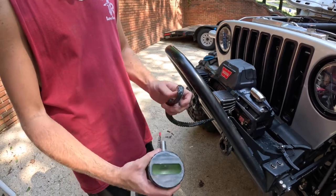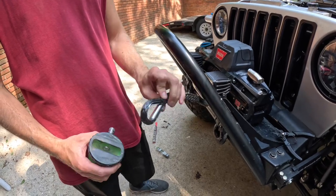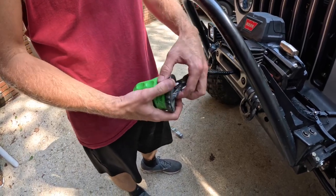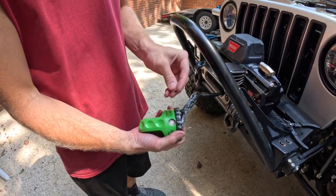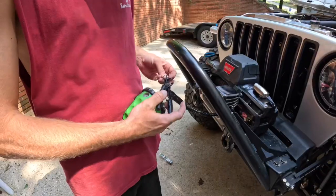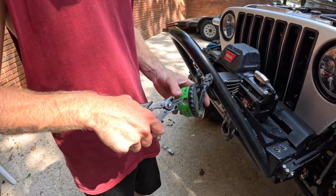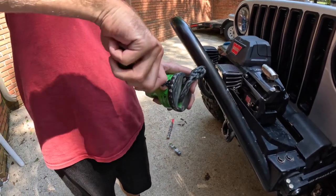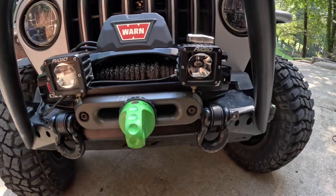It's time to reinstall the Factor 55. He's got the Pro Link — it's kind of their oldest design. People always wonder how these things work: the winch cable came with a loop in it, which literally just slides in the bottom. You've got a pin that slides through the Factor 55, and then it also comes with a little snap ring — you need a set of snap ring pliers. All this does is go in here to retain that pin. Stick it in, make sure it's seated, pull your pliers out — that's it.